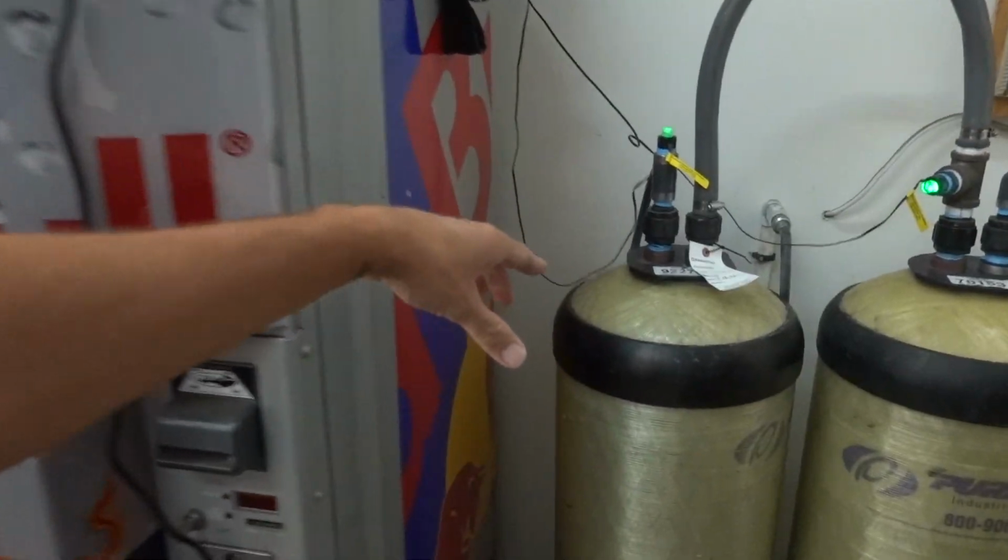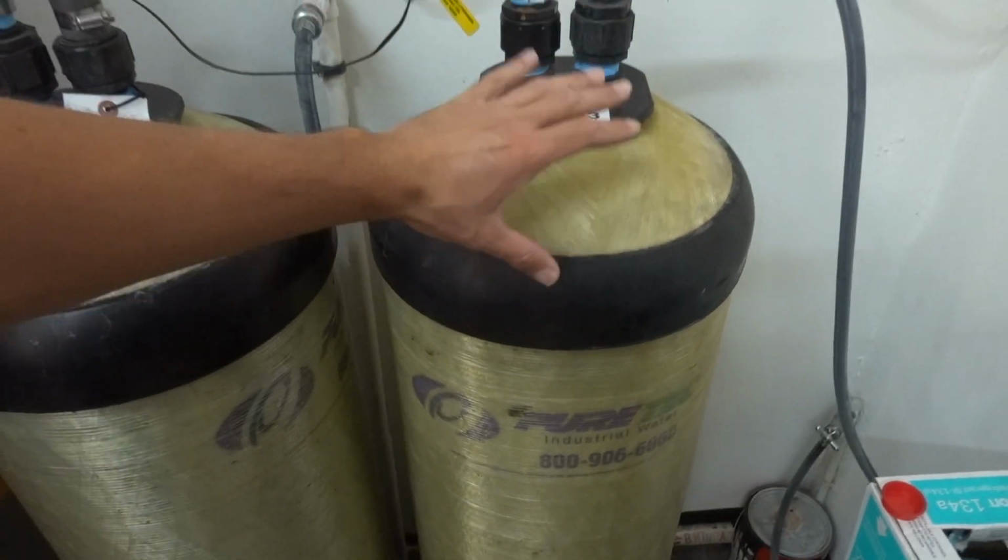Well, we made it back from dropping the bikes off, and just check out all this room we got in the shop here for activities. Snow's truck's gone. Client's trucks are gone. We also got boom, 2 new Freshie Pure Tank deionized water tanks here. The other ones were put in February, and we do quite a bit of washing here. So they say about 1,000 gallons apiece. Basically what I do is I let the first one turn red. The second one then does most of the work, and then we'll swap it out once the second one turns red. So about 2,000-ish gallons. I personally think we're getting more, but.